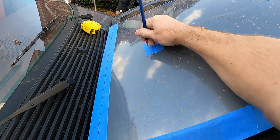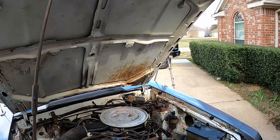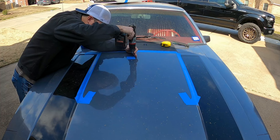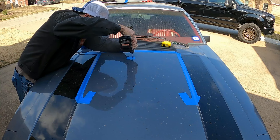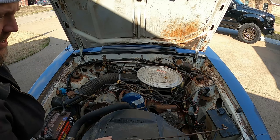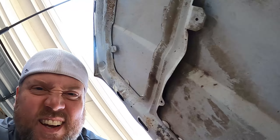From the tap method I've confirmed the measurements and it should be right over the factory dimple. We'll drill a pilot hole and go from there, but I need to figure out the other holes too. First things first — drilling a tiny pilot hole, because if I had to fill it back in, pilot holes are much easier to fix than a 3/8-inch hole. The measurements are right; it should be right in the center. There's the hole — right where I suspected. Perfect.